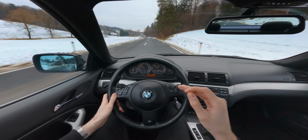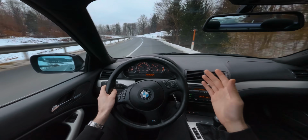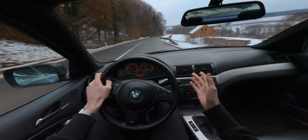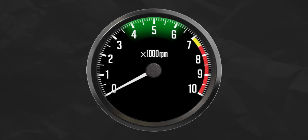Oh yeah, and one more thing about engine tuning. Focus on response and usable power. Most cars with electronic throttle pedals are tuned for general comfort, but you can get a lot more response with just a simple ECU tune. And usable power, a street car benefits way more from mid-range torque than from chasing high RPM peak numbers.